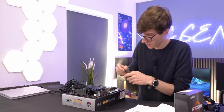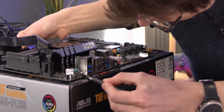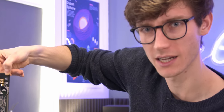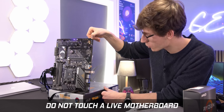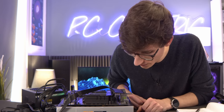Moment of truth — let's press this button for three seconds. One, two, three. Do not touch your motherboard while it's on. This is now just going to blink nice and gently, probably for a few minutes, and when it goes out it should mean that the BIOS has been successfully flashed. I imagine it will blink a different colour if there are any issues.